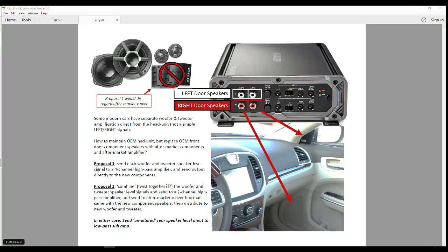If this is the unit you're working with, you'll want to examine the specs of the new woofer to figure out how high it can play, and examine the specs of the new tweeters to figure out how low they can play, then set the crossover dial on the head unit to a value both can handle. For example, if the tweeters can play down to 2,000 Hz and the woofers can play up to 3,000 Hz, set the crossover to around 2,500 Hz. Once you set that crossover, confirm which left lead is playing lower sounds and which is playing higher, then connect all outputs to a four-channel amplifier to power the separate woofers and tweeters. You won't use the separate crossover box that comes with the speakers, because the crossover is being done inside the head unit.